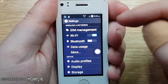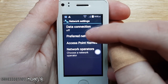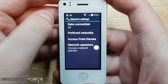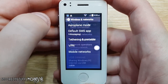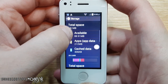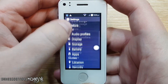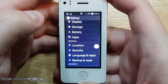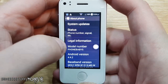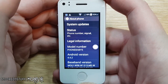Looking through settings — Bluetooth, preferred networks: Optus 2G/3G. I'm getting to the point where I think this is only a 2G phone because I can't connect to any mobile network. In storage: phone storage is 151MB — the box said 512MB ROM but it might be 256MB ROM. It does detect my SD card, which is good. Battery is at 90% — I fully charged this three or four days ago. In 'About Phone' it's called the Phone Baby 5, running Android version 4.4.2.